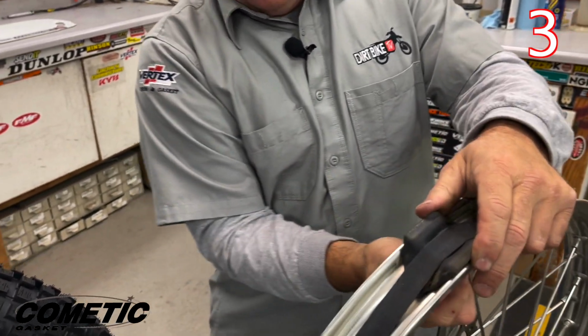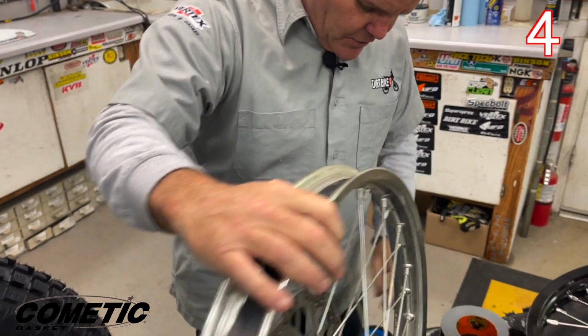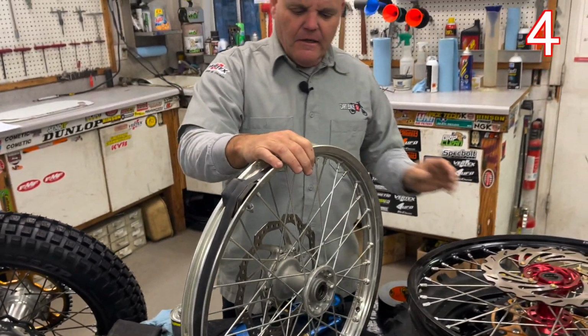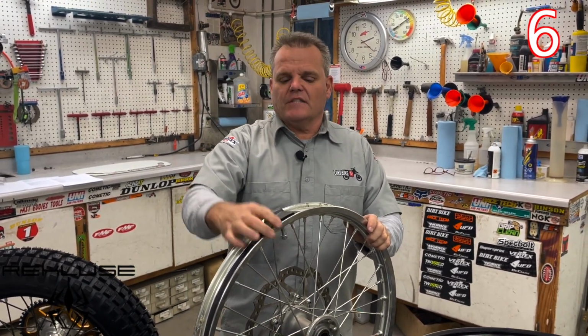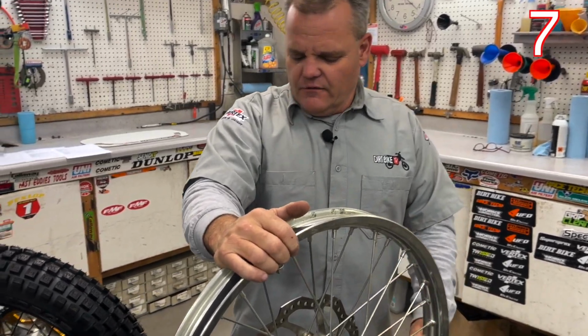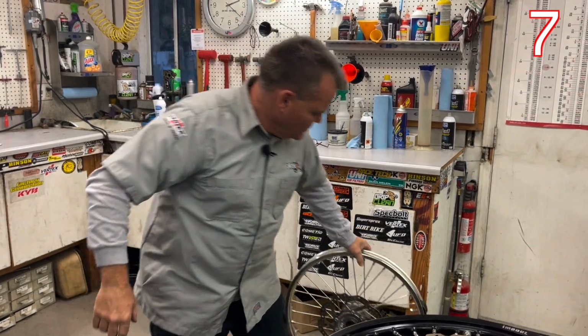And this is a good stock style rim lock. Also, Motion Pro has good rim locks, rubber coated like this. That's a rim lock we would like. Fronts take a 1.6 rim lock on all big bike fronts like this. And then rears, like for a 125, it'd be a 185 size rim, and rears are all 215 for all the bigger bikes, 18-inch wheels and all the bigger 19-inch wheels on the bigger bikes. Okay, so that's a look at setting up your wheel.